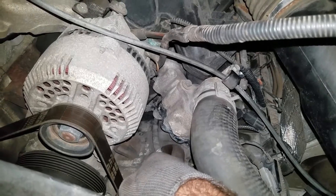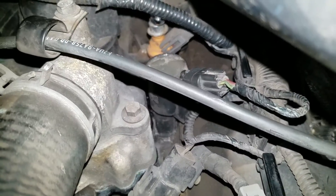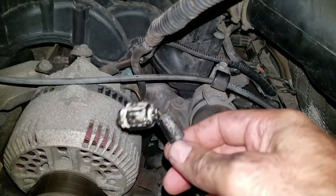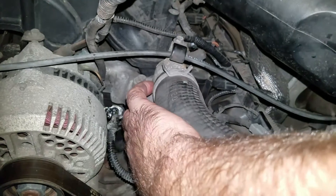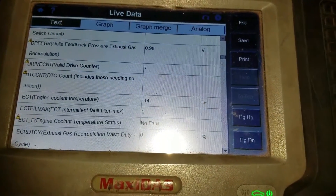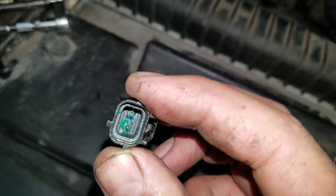I've got to find the engine coolant temp sender — I think it might be right there under the intake manifold. Another thing I noticed was this intake is leaking; his coolant level was low. You can see it's wet right where the aluminum and the plastic meet — happens all the time. I'm gonna replace the intake manifold and try to get at that temp sender. I got at the temp sender and it's nice and wet, probably from that leaky intake manifold. I barely touched it and the thing broke — I just wiggled it a little bit and when I tried to push the tab to unplug it, it broke.